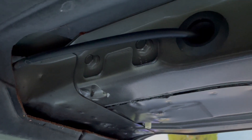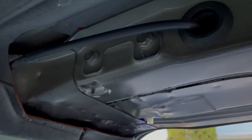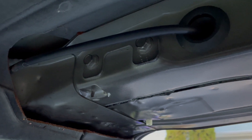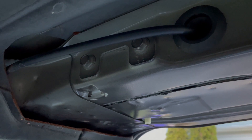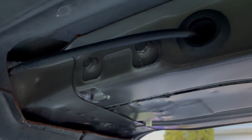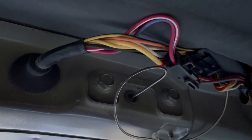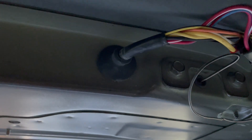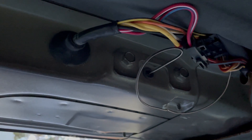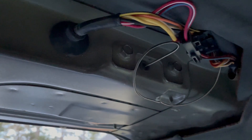This is the main event — this is where you've got two bolts on each side that run through a bracket, and those go into the hinges for the tailgate. I like removing them here as opposed to on the tailgate itself because then everything should remain relatively lined up — there are two there and two there. You're also going to want to disconnect the connectors, and they will pull through this little rubber grommet right here. That'll go with the tailgate, and when we put in the replacement tailgate we will shove those wires back through and reconnect everything.